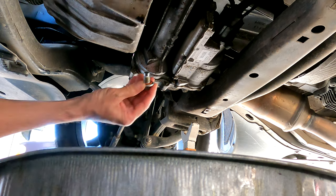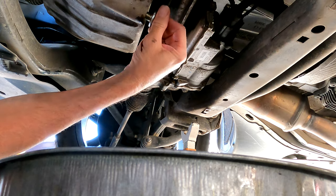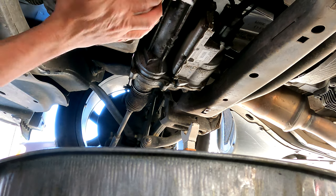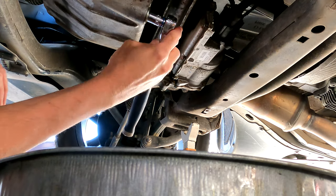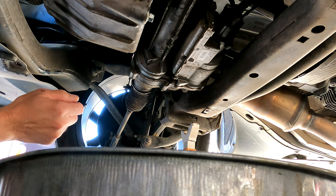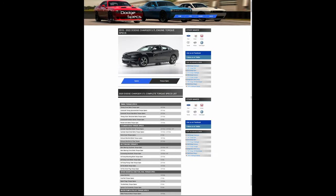Okay, I think that's good enough — it's down to a drip, drip, drip. I did clean off the drain plug. I did not change the gasket — it is not leaking in the least. I don't even see any seepage around it. I'm not going to super torque it because this is an aluminum pan and I just don't want to strip out the threads. We'll go ahead and torque the oil drain pan bolt to 25 foot-pounds. That's good.